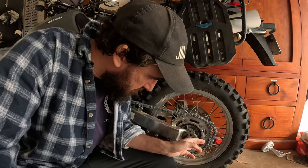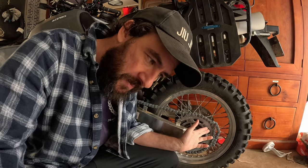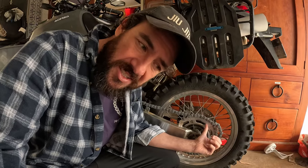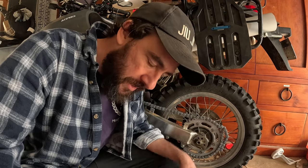It started raining and got a bit late last night, so I didn't finish. I put the thread locker on and then didn't torque it down. So I guess once I actually adjust the chain and everything, get the chain set right, I think I have to pull this back off, reapply the thread locker, and reset it.